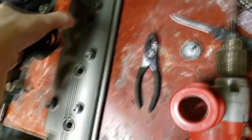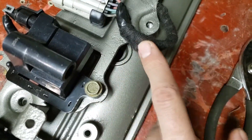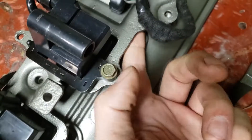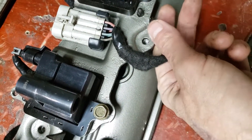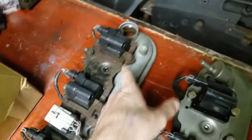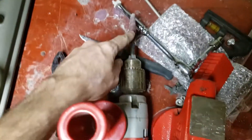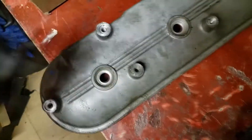I did the whole harness — took out the old crap. Originally there are some spots for mounting the clips, and I re-loomed it. Then you end up with a bare coil bracket — just bare metal. I took a wire wheel and cleaned up all the crap, took it to all the surfaces. For all the stuff I couldn't reach, I used this sanding bit mostly on the valve cover to get into the grooves that go down the center. That helped a lot.